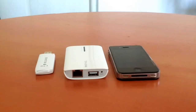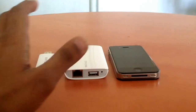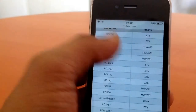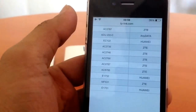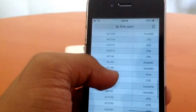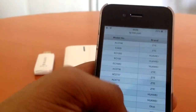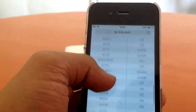The setup is going to be simple. Firstly, before purchasing your wireless router, you need to ensure whether your device is compatible or not. If you go to the TP-Link website, you will see a list of compatible devices for the MR3040. One peculiar thing I found was that the AC2791 is not listed there; however, it is compatible. Make sure you read the compatibility list, and if not sure, you can ask people who already bought it whether your dongle is compatible.